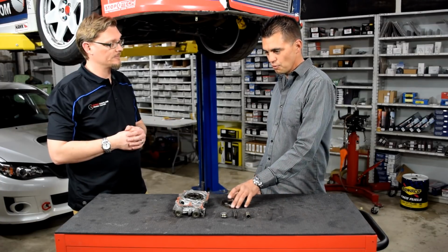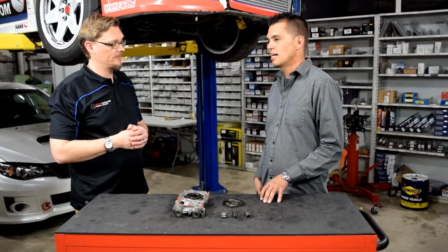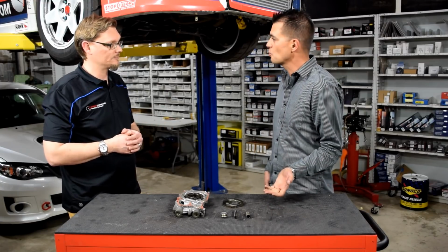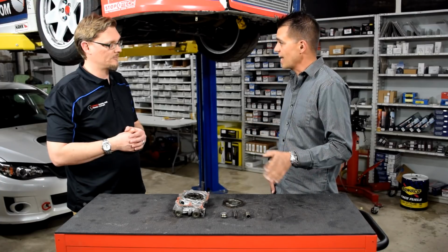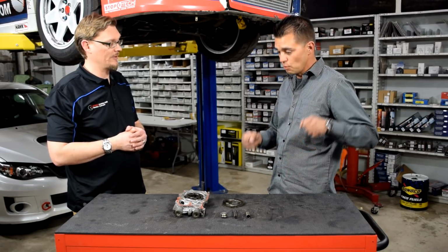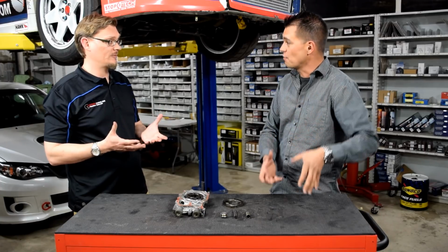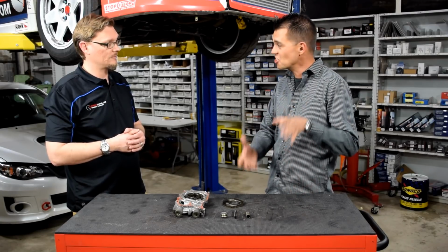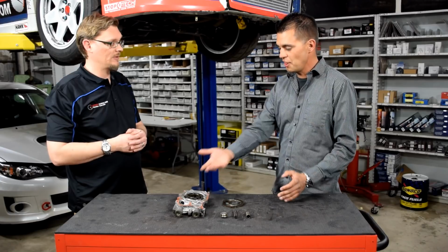Power levels. So for volume and pressure, for folks that are stuck on one of the concepts, it's important just to visualize that sense. We have a snorkel and we have a 10-inch diameter pipe. And a snorkel pipe is probably 1 inch in diameter. We put fluid through there at X pressure. Let's just call it 80 psi. And then we also take a 10-inch diameter pipe and we fill it up to volume and also pump 80 psi. We certainly visually have a completely different volume. I could run more volume. Exactly. I could run the 10-inch pipe with significantly less pressure, but have a ton of volume behind it. Versus this 1-inch pipe that has very little volume and a lot of pressure. So that's kind of the observation of what we're seeing.